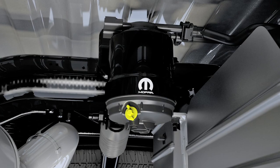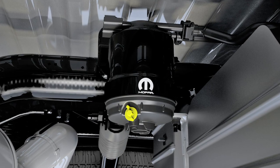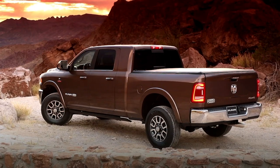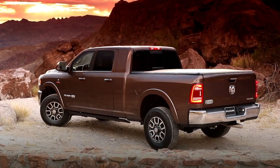The drain sensor should not be over-tightened during normal service operations to avoid internal damage or future fuel leaks. The drain should be secured without the use of tools.